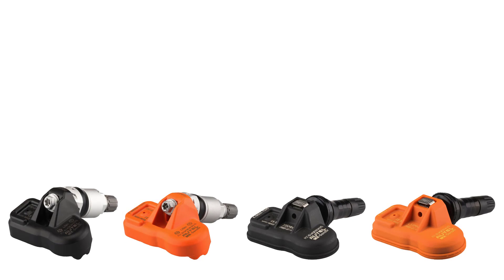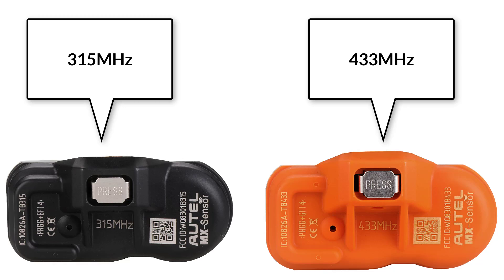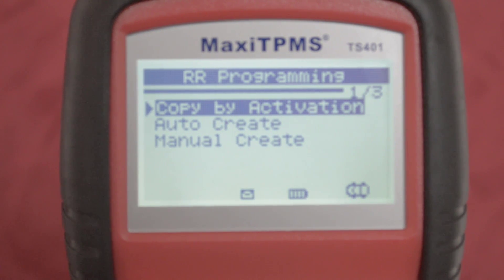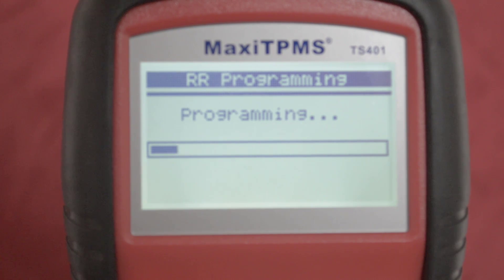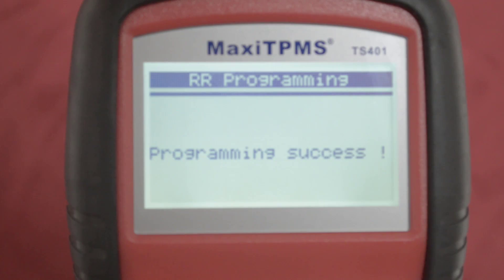The question then becomes, is there an easier way to replace sensors? The answer is definitely yes. With the Autel MX Sensor line, you only need to stock two sensors to have 98% coverage for vehicles on the road. These two sensors represent the frequencies of 433 and 315 MHz. No longer do you have to wait on the parts store or a dealer to get the right sensors. To get into the MX Sensor programming screen, be on the trigger menu and press and hold Y. Autel gives you three different ways to program sensors. First is Copy by Activation, which gives you the ability to scan a sensor that is broken but still transmits a signal, then copy that sensor ID into the new MX Sensor — allowing you to replace a sensor without doing the re-learn procedure.